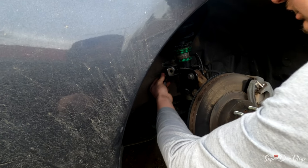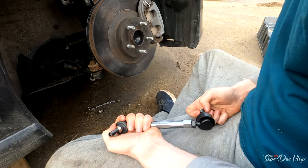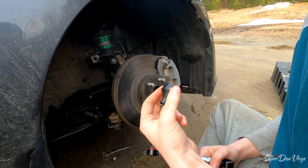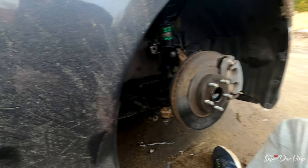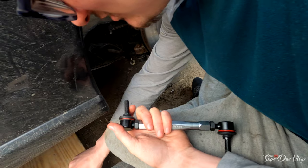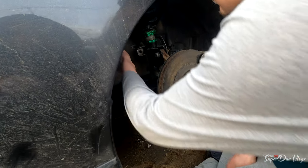They're gonna go with legs down — that's the way they go. You're gonna take the plastic bits off. Remember, kids, if you ever install aftermarket sway bar end links, take the plastic covers off. I've actually seen people install them with the covers on and then wonder why their sway bar falls off 40 miles later. I'm not a car guy — Chris is all about the cars. He says cars are all just a system of bolts when it comes down to it.